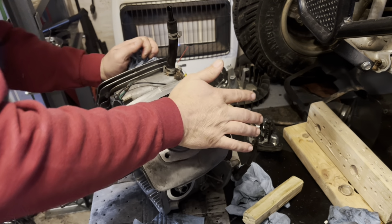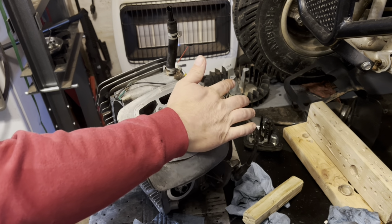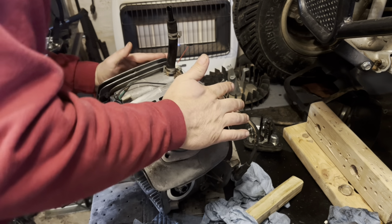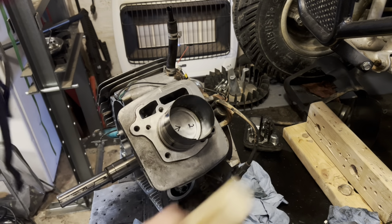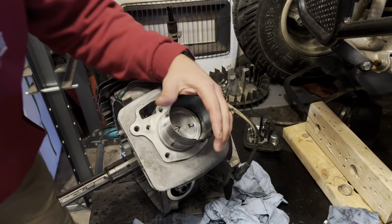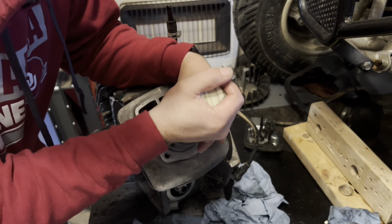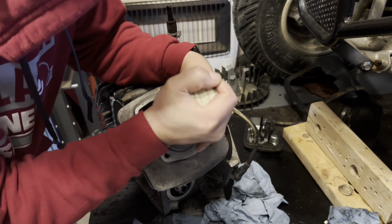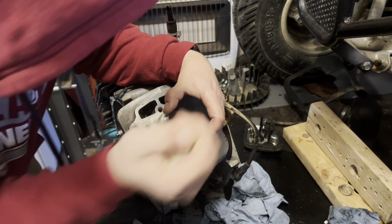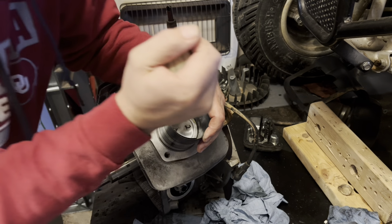This down again a little bit that way. And you don't need a big hammer to do this, but when you do it, you do want to hold down on this, because those rings, they will pop this thing out of place, and then you got a bit of a jam. Kind of keep an eye, make sure everything is going your way on the crank.